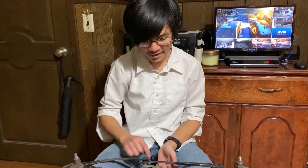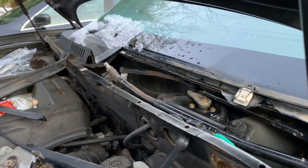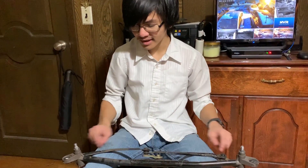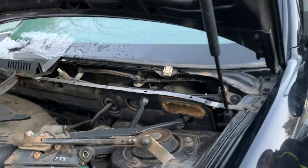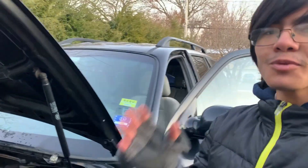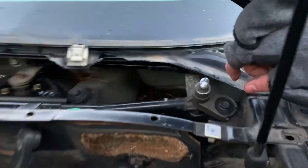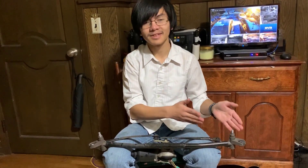The way this system works is basically the motor spins this little crank, and as this crank spins around, this pivot point right here takes these two bars attached to it and they also rotate in a synchronized fashion. So if you ever wondered how a windshield wiper system works: the motor spins a linkage arm like a crank and flywheel, rotating it and causing both of these studs to pivot between two points — around a 90 degree angle — turning both wipers at the same time.